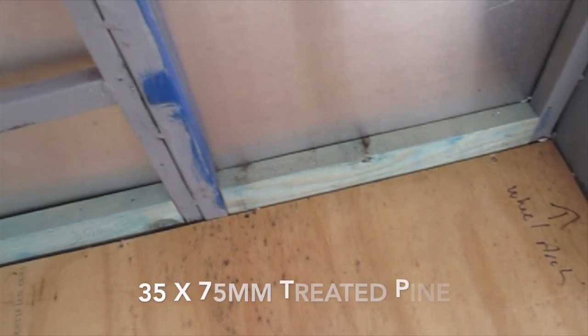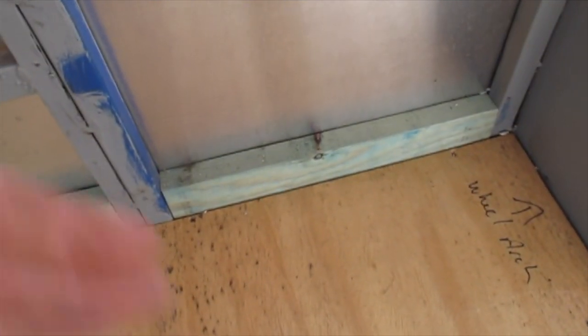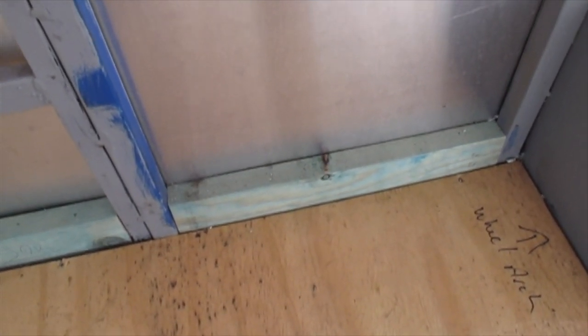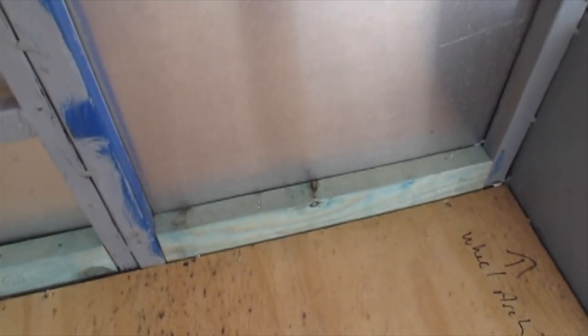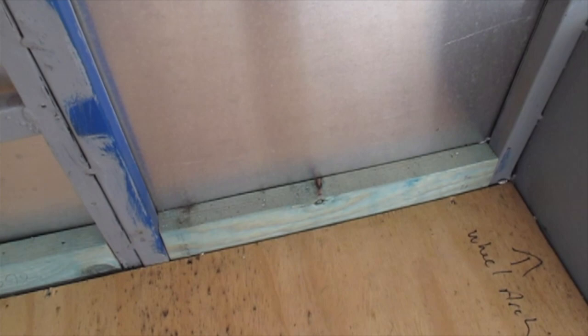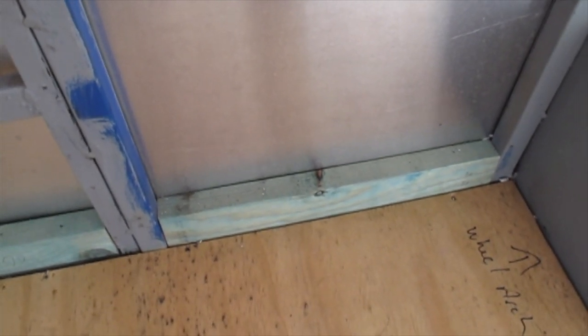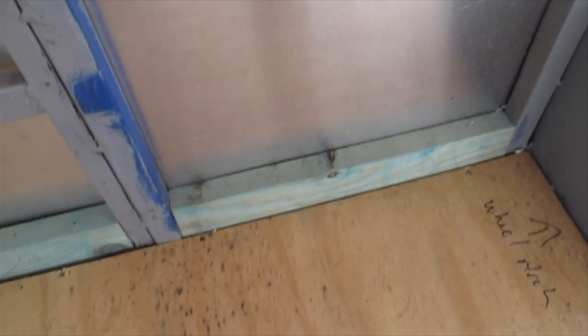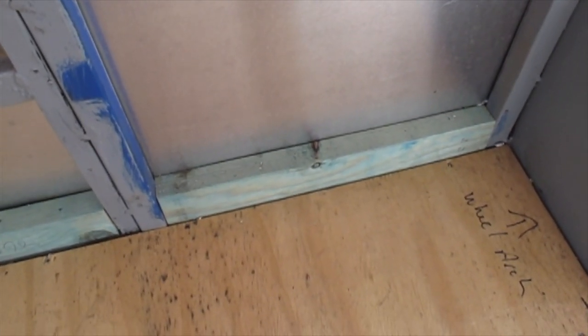We put the cladding on that's been glued in place, right around the van. The aim of that is to give some backing and somewhere to screw the interior lining on, which we're about to commence. It just makes things a little bit more rigid, takes the belly out of the plywood, and when you go to attach the coving and things you need pressure at that point — without it there you get flex in the plywood, and we don't want that.